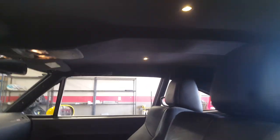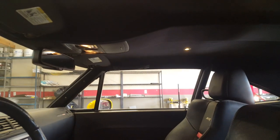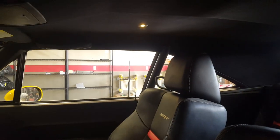The courtesy lights came on and I'm happy about that, because if they hadn't I'd have just put black tape over them — getting them out now is nearly impossible with the headliner installed. You'd have to remove the entire back seat section to free it up. The headliner goes in first, then all the side panels, the corners, and the package tray in the back all go in and trap it. This end goes down behind the side panels, making it quite a job just to drop it down and unplug one of those little lights.